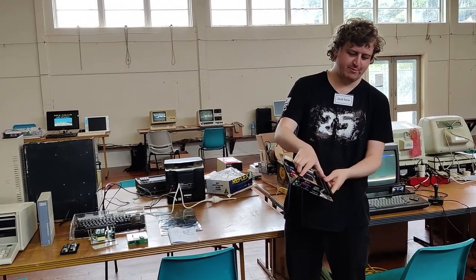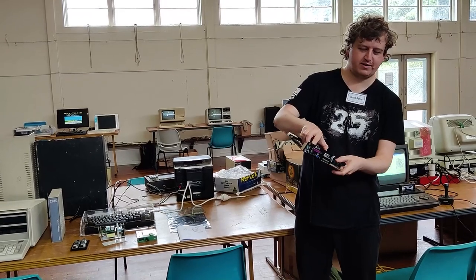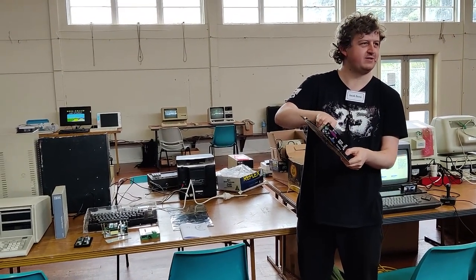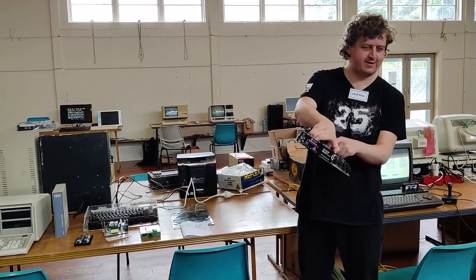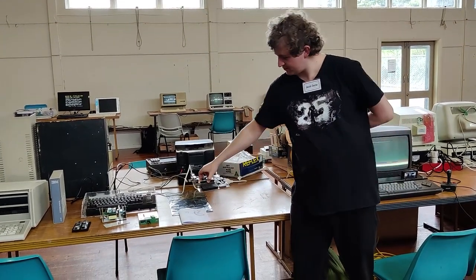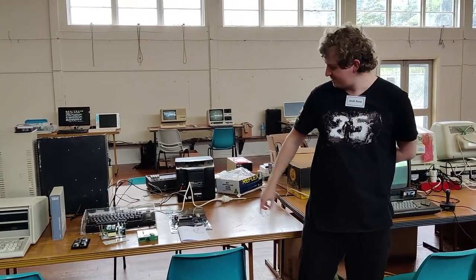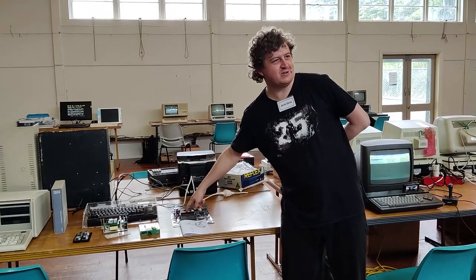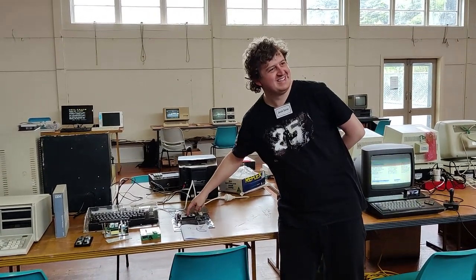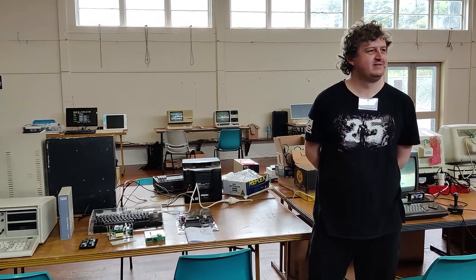It can come optionally with this VGA PC-104 card, and it just routes to there, or you can not get that and put an ISA card in. It's equivalent to a 10 MHz XT, so it's got an 8088 on it. You can switch it down to 4.7. So, VGA XT. Yep. The card is more 90s oriented, but it's all about what chips I can get, and I managed to get those, and they work great on an 8088.